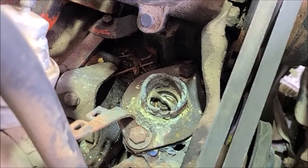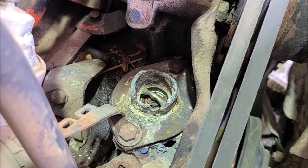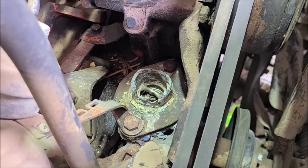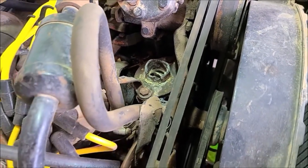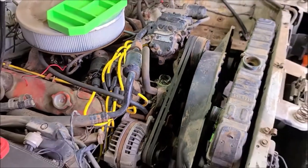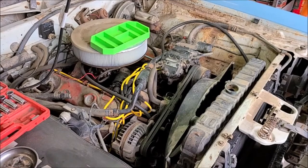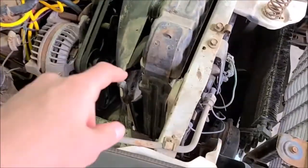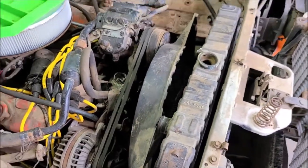Oh, and this thing here. It was leaking coolant. I thought it was the water pump that was leaking, but it ended up being this, I don't know, you call that thermostat housing, where the upper radiator hose goes. It was just completely rotten, so I got one of those. So we'll go ahead and go through all that stuff today. Nothing exciting, it's kind of maintenance things, but this will actually allow us to drive the car a little bit more. It was just spewing coolant everywhere. There's a crack in the radiator here, and then that thing there was leaking like a sieve.